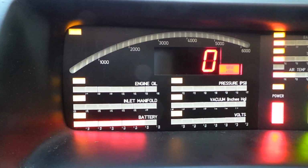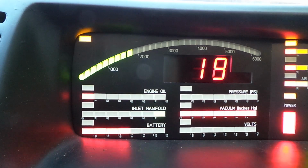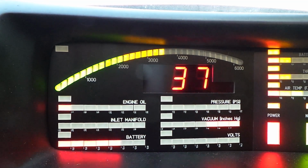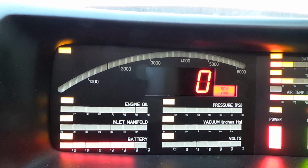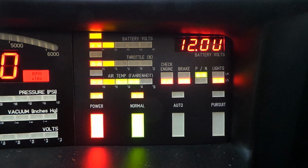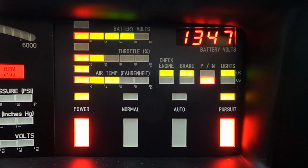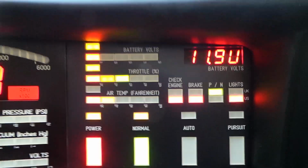Dash module number 4. So again we have our dash module number 4, push button 1 and push button 2. Let's press and hold push button number 2 for 2 seconds. And it will go into show mode. You can hear that clicking sound as well that we've used to replicate the sound. That's optional, you can switch that on or off. Press and hold again for 2 seconds, and it goes back into normal running mode. Dash module number 5, similar kind of thing. Push and hold push button number 2 for DM5, and the whole thing will go into show mode. And push and hold it again for 2 seconds, and we're back to normal running mode.